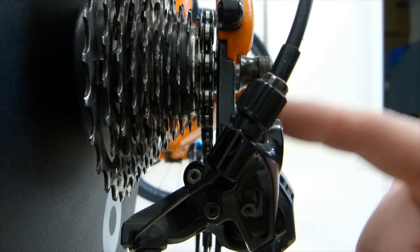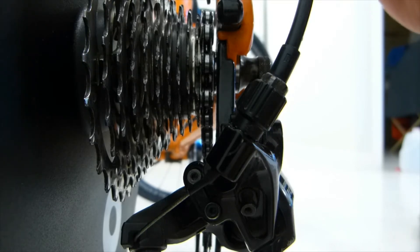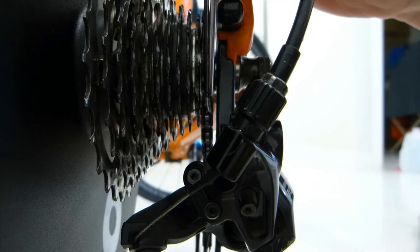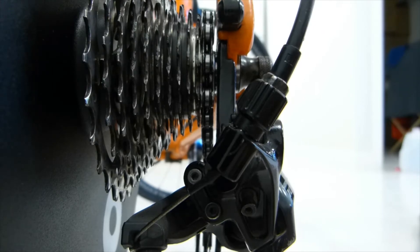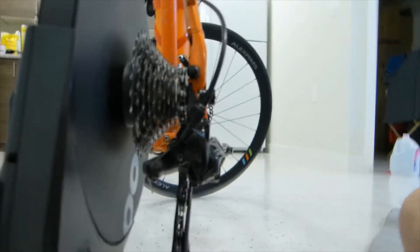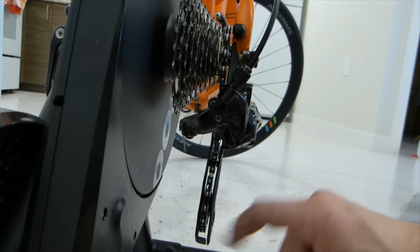Before I start bending it and go graphic on it, I want to show you the vertical alignment — or lack thereof. A straight line should be made from the center of the chain up here at the top of the sprocket, to the center of the chain at the bottom of the sprocket. And this straight line needs to be carried all the way down to the tension pulley there — the end of the tension pulley.